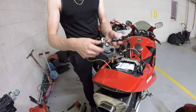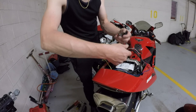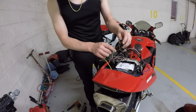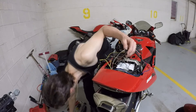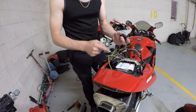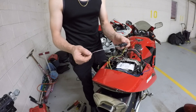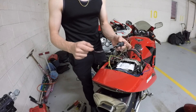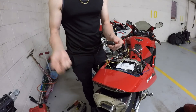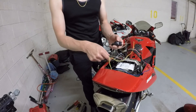So basically, here's my ground wire, which I know is a little hodgepodge, but I'll have this connected under the screw here with one of these connectors when I'm done, and I'll solder it all together. I just tested it to make sure everything worked. I color-coded it so red was my power in, black was my ground, and I made both the turn signals blue. If I get them wrong when I'm checking it, I'll just flip the wires real quick before I solder, and I'm good to go.